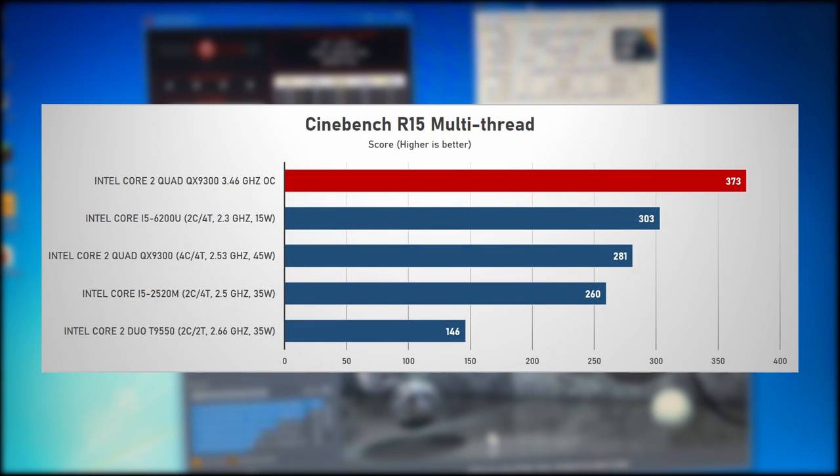Now easily overtaking the Skylake i5-6200U — really an absolutely phenomenal overclock for a laptop. These Core 2 Quad mobile chips certainly weren't common. Back in 2008 many applications were still not optimized to take advantage of more than two cores, so in many cases you're better off spending less by opting for a higher-clocked Core 2 Duo instead. That's why not many machines were configured with these chips, so I was quite happy to finally find one with the elusive Unlocked Xtreme Edition. In terms of performance we saw that in certain multi-threaded applications it can still keep up quite well with more modern dual-core chips with hyper-threading, albeit at a much higher power draw. And also that in other applications there's simply no getting around the age of the Core architecture — although you could certainly make up a bit of that by overclocking if you really wanted to throw all common sense out of the window. It was fun though.